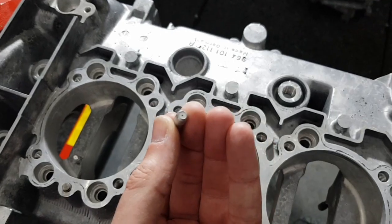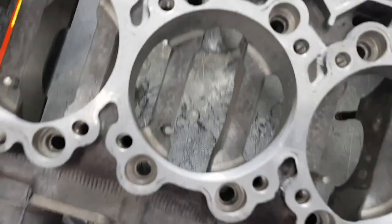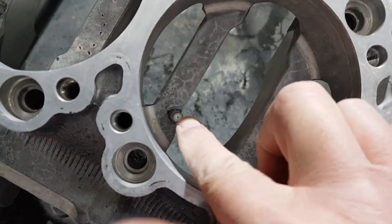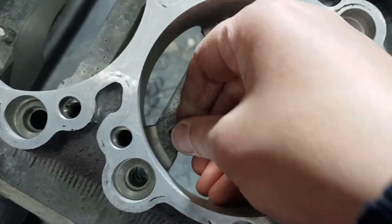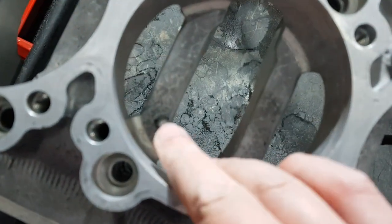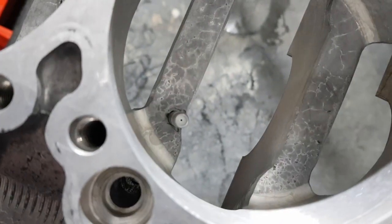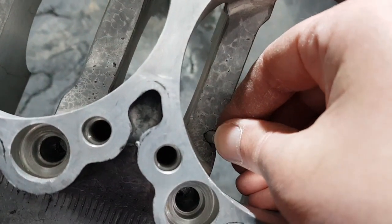This is one of the new piston squirters that's going to go in. I've dropped the first three into place on this half of the block — you can see one just here. They're a good tight fit. They will push in to just below the surface, and then once below the surface the top will be peened over to hold it in place.